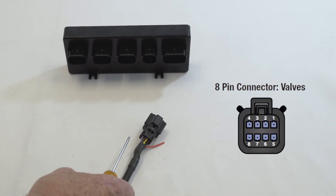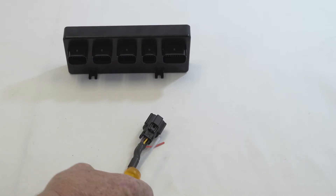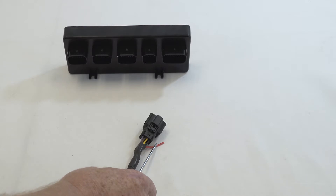The wires underneath correspond to the down valves for the same exact corners — so pins five, six, seven, and eight on the bottom. The ones that line up on top are your ups and the bottoms are all the downs. If you have an illuminated valve top, like on the Slam Specialties SV8 or on our valve block, this wire can connect either to your trunk light or to your key-on, so that it only illuminates when the system is running.